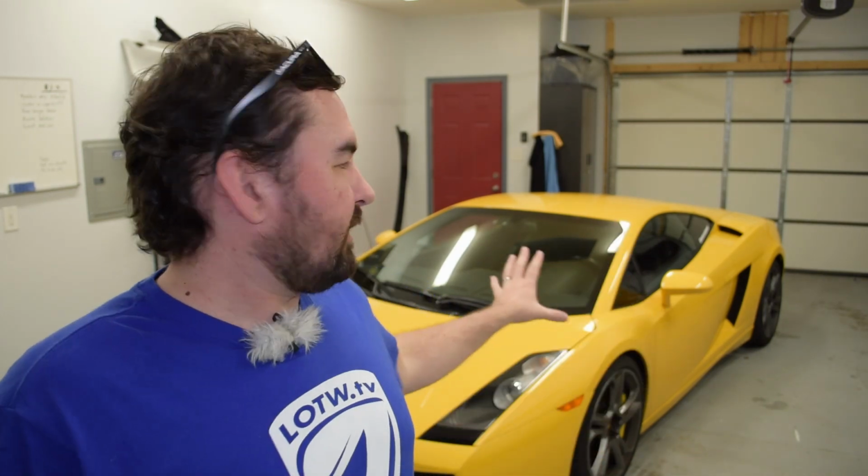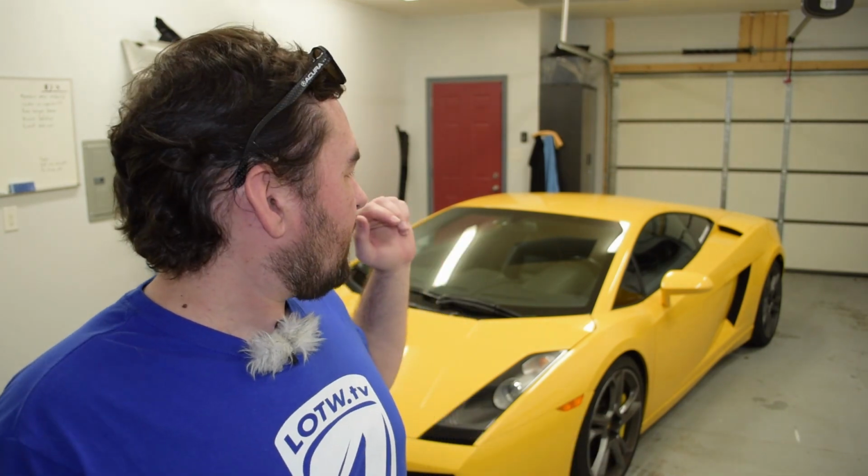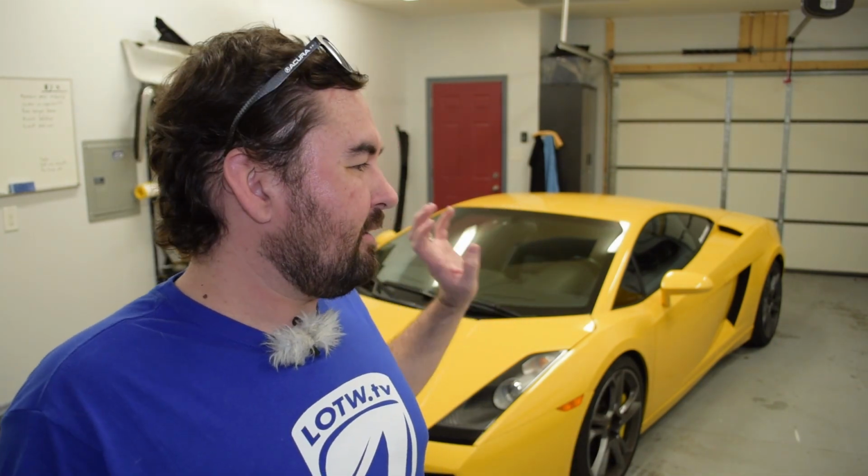I had actually suspected, after I watched the earlier video where I autocrossed the car, that there was a stumble or a misfire. I had originally attributed that to probably the VVT. This car is interesting. It's kind of entertainingly similar to the NSX in certain ways. It has both a variable volume intake system similar to the NSX, and it has a variable valve timing system, as actually most cars have since the NSX and preceding VTEC for that matter. So this has both of those types of systems, and the VVT, the variable valve timing, was somewhat amiss, but that's been resolved.